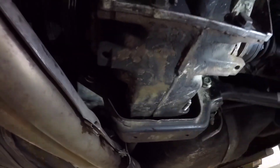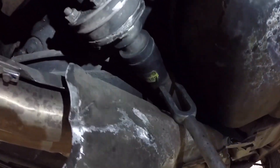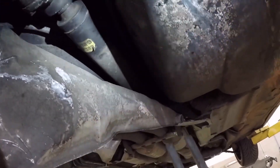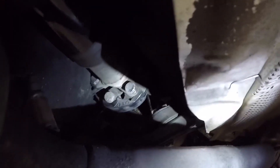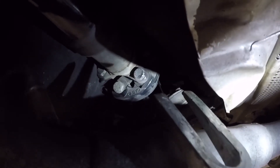The diff keeps jumping and that's not a good sound or structural thing. I'm guessing there's a sound coming from the center of the drive shaft, which could mean the center bearing is shot. Also, when driving the car fast, the bushings are completely dead and I'm going to need to replace those as well as the guibo.